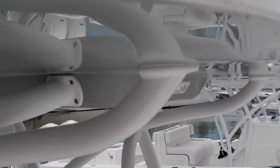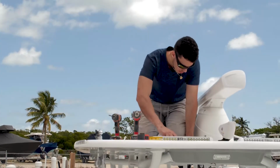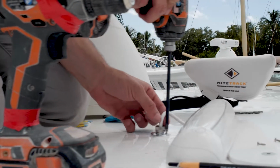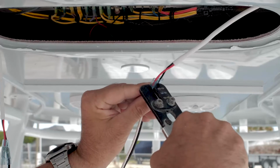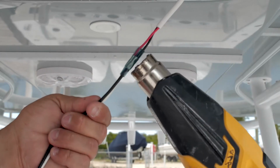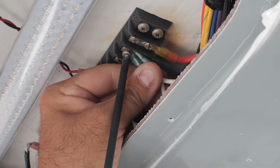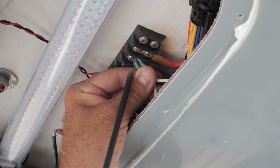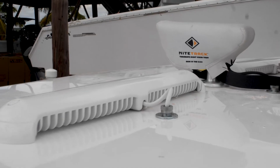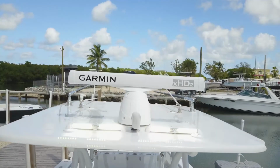With all lighting products, it's important to pay attention in 3 areas: the boat system voltage, the amp draw from the lights, and the length of the wire run needed. Always ensure your fuse is large enough to cover the total amperage of the circuit. Make sure your wire gauge is heavy enough to handle the load. There are many online calculators to assist determining correct wire gauge. And always make your calculations using the correct system voltage for the most accurate results.